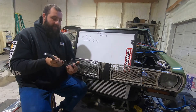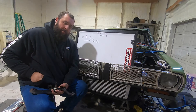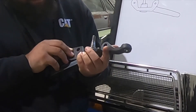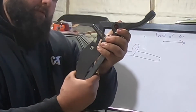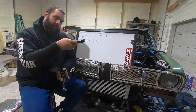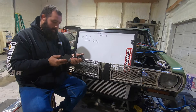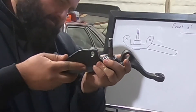Big, heavy plate — I'm going to chop this off. A lot of people will weld this directly to their spindle. I'm not actually going to do that, even though it would probably work better in my opinion. I've got another plate here — this has all got to get bent. Basically it's going to bolt through here, then it's going to get bent down and then out a little bit. This is going to get welded flat here, bolted, and welded along the seam. In all honesty, it should be way overkill for what the car weighs. That's kind of my plan — to have it like that.